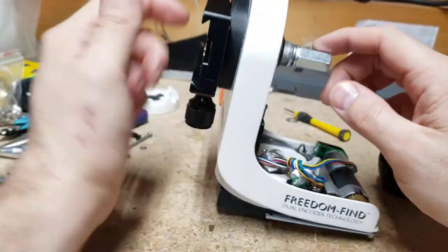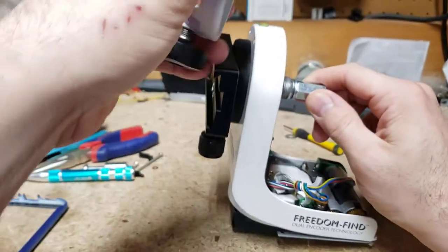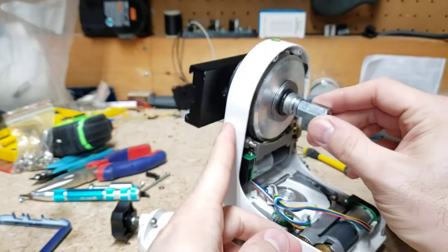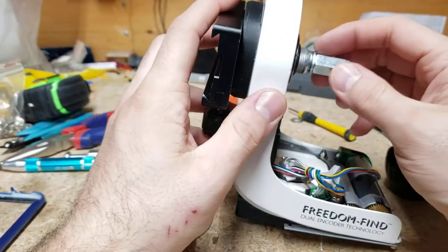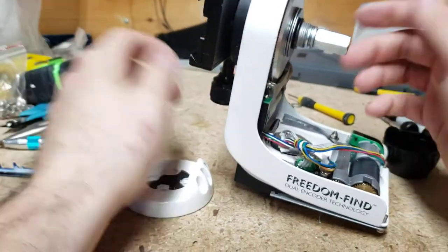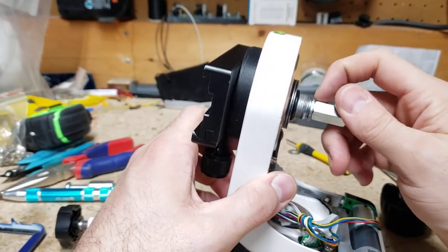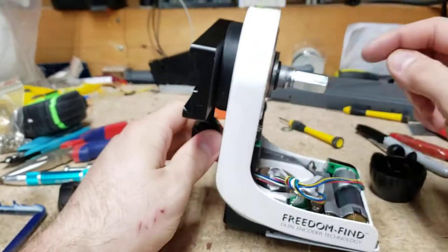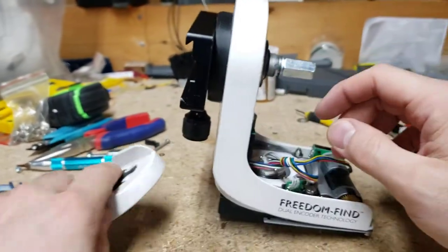It was pretty extreme actually, so I ended up just putting an M8 bolt through here. Up in here there's an M8 thread. If you have a stock unit, you take off the little sticker, there's some screws, you take those off, and inside there's enough room to accommodate an M8 bolt. That comes down to about here. I just had some threaded rod and cut it with a lock nut up in there to make my own, just to avoid buying an M8 bolt. Then there's a washer, a lock washer, and another washer to keep it all flat in there, and then an M8 coupling. That's all jammed together so this can rotate freely. I can put my Skywatcher Star Adventurer counterweight rod in there because that's M8 thread, and it's all perfectly straight now.